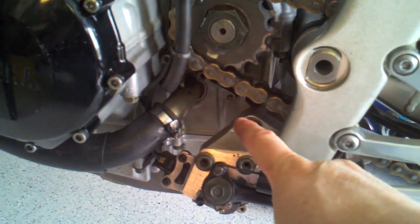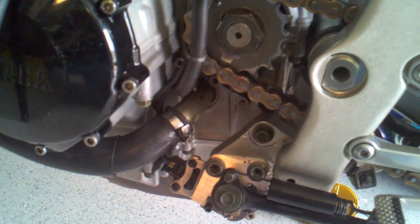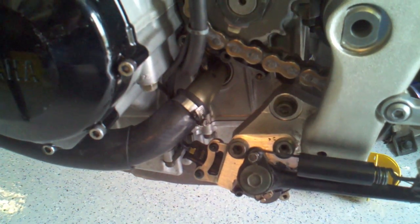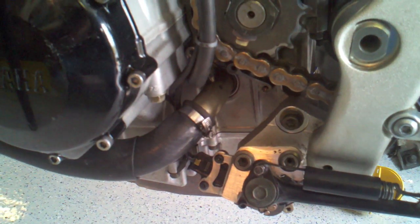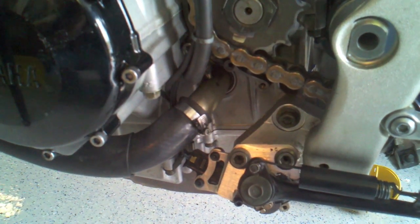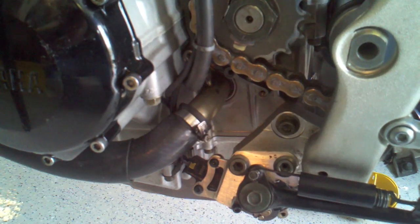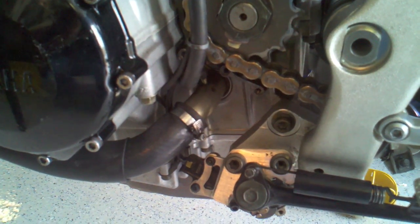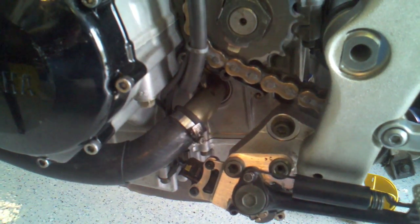That squeak, I've run the motor and put my ear all over the different parts of the engine, and I'm pretty sure that noise is coming from down here in my oil water pump, which is the one piece in the motor I felt the least confident about, even though I did rebuild it. It just seemed like the impeller shaft had a lot of resistance. There was quite a bit of wear on the inside cap on the oil side, which I didn't notice till the very end. But I polished things out best I could.